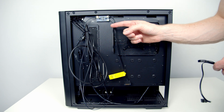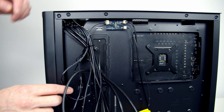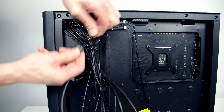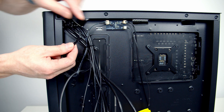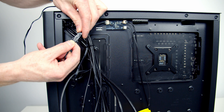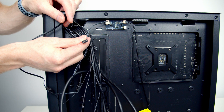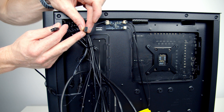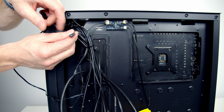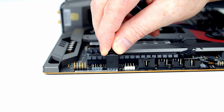I'm planning to do a case review where I'll show you all the ARGB effects. What I'm going to do is follow the cable coming from the left-hand side of the controller and unplug it from the controller. We're going to ignore the end that goes into the controller; it's the other end connected to all the fans that we're interested in. We'll plug this into the cable that came in the accessory bag, and on the end of this we've got a standard 3-pin 5V ARGB connector — we also have an alternative ARGB connector depending on your motherboard type — and it's just going to plug into one of the ARGB headers on our motherboard. Down at the bottom of the motherboard, two pins along from the HD audio cable, we've got an ARGB connector. Be careful — the connector one pin along from the HD audio connector is not an ARGB connector; it looks like one but it's not.